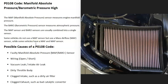The next thing that could cause problems is some kind of issue with the air going into or out of the engine. This would be like a clogged intake — such as a dirty air filter — or a clogged exhaust, like a bad catalytic converter. Usually if that happens, you're going to get other codes as well, so if you are getting other codes, be sure to pay attention to those.